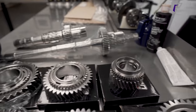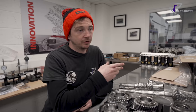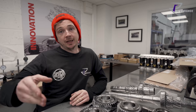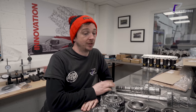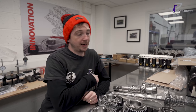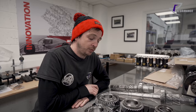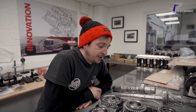That's pretty much the internal gear kit — two shafts, all the gears. Second gear is what normally breaks on these as stock, probably limited to about 600 foot-pounds. But remember a gearbox is a torque multiplier — if your engine makes 600 foot-pounds and first gear is 3:1, the transmission is dealing with 1800 foot-pounds. That's why you always see failures jumping into second: you spin through first, then in second you have full traction and full torque, which is when things exit the transmission case.